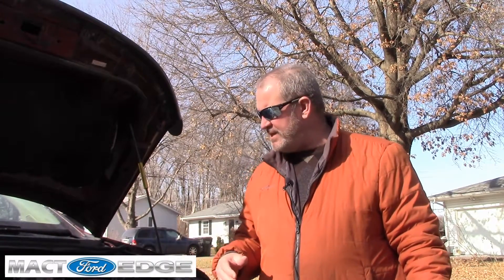Welcome back folks. MACT Ford Edge here and I'm going to revisit the coil testing because I'm going to cover another test to verify how to determine if a coil is good before you install it. I was a little short on the first one, I apologize, but this is going to be a make-up video for that coil resistance testing. I'll go through both of the tests, checking through pin 1 and pin 2 through to the coil where it actually makes contact with the spark plug itself.